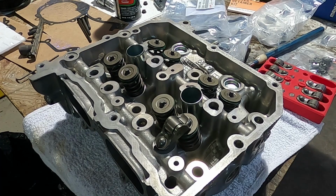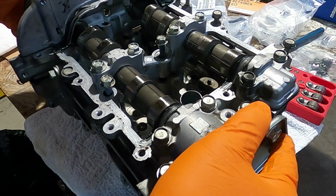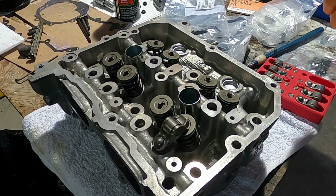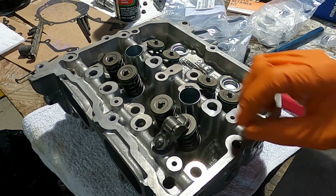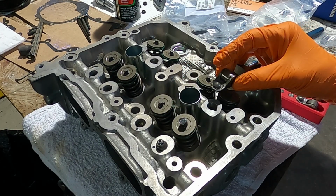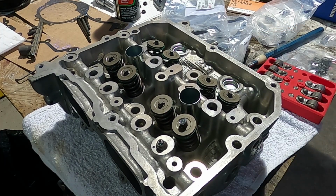So what these rocker retainers do is ruthlessly simple. Normally your camshafts sit up here, like so, and they slap that rocker. Now what happens is, at speed, when those are spinning faster and faster, if the valve floats for even a split second while that push rod is compressed because of the speed it's going, this will just drop, because this is obviously mounted vertically. This will drop, and when that does that, it just goes down here into the area under the cam on the bottom side, and it just pitches it out.